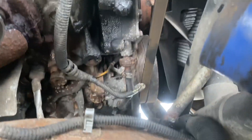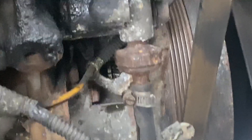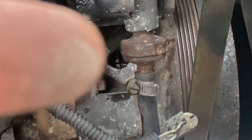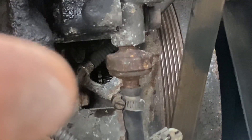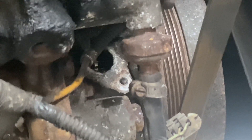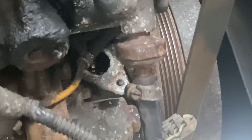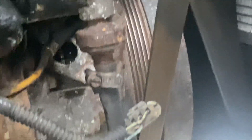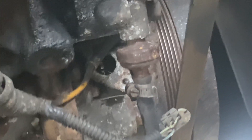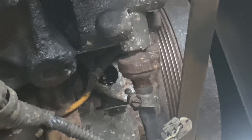I'm going to try to zoom in. You can see by the tip of my finger there's a little gear in there — that's where the old sensor came out of. Just below it you can see a small little bolt hole; that's where the 10mm bolt was. And right below in the middle of the screen, that is the electrical pigtail. It's actually kind of easy to get to.